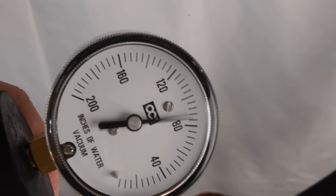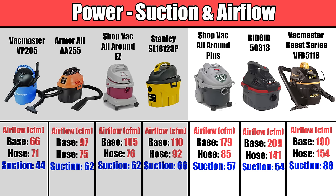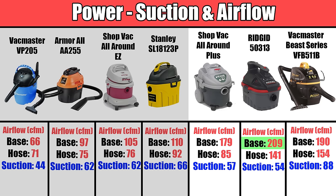With the premium suction and airflow tests, I was blown away. These airflow numbers are super high — higher than any regular vacuum cleaner on the market. But I suppose that's par for the course with premium shop-vacs, though they do require some explanation. The Rigid had higher airflow at the base, with the Vacmaster Beast coming in second. But the Vacmaster had higher airflow at the hose, which is probably just due to the Rigid having a longer hose and thus a longer distance for the air to travel. The Vacmaster has quite a lot more suction at 88 inches of water lift, and suction is much more important with wet-dry vacs than it is with regular vacuums.